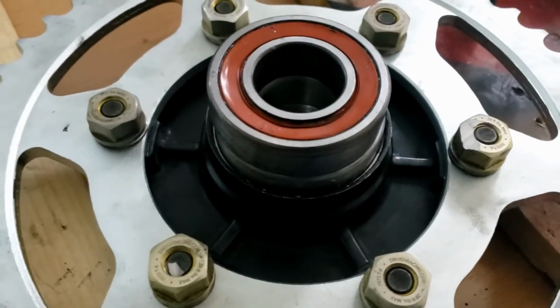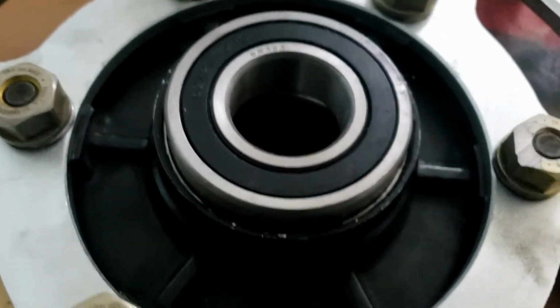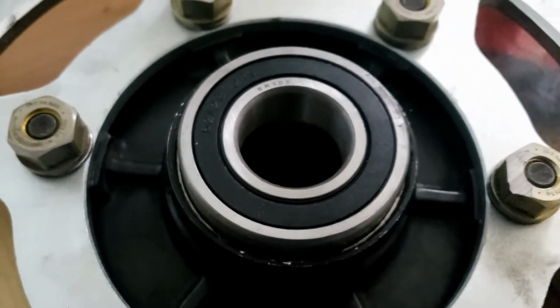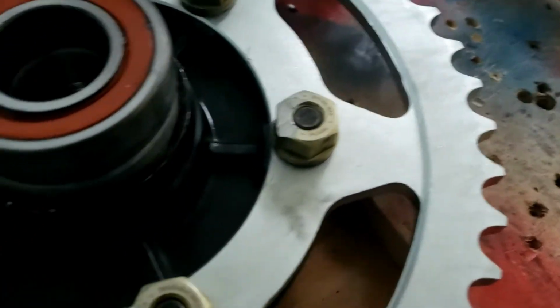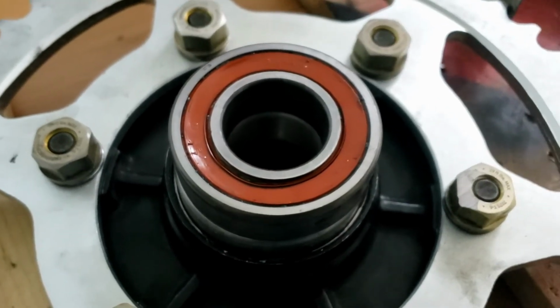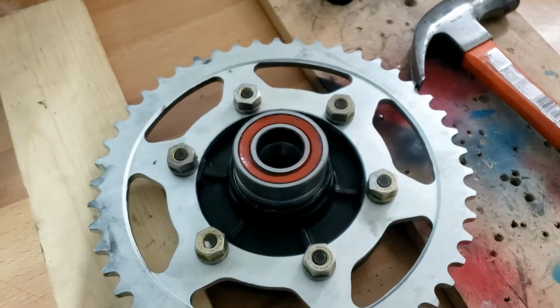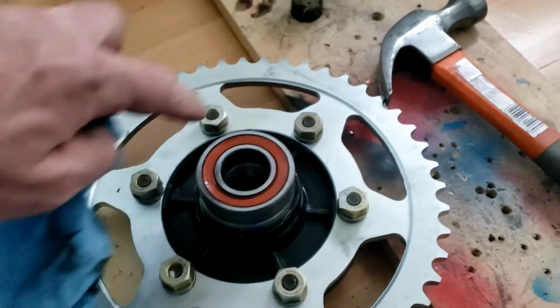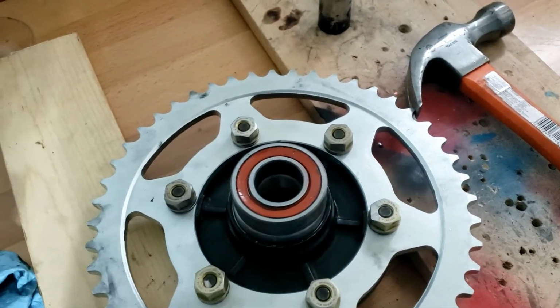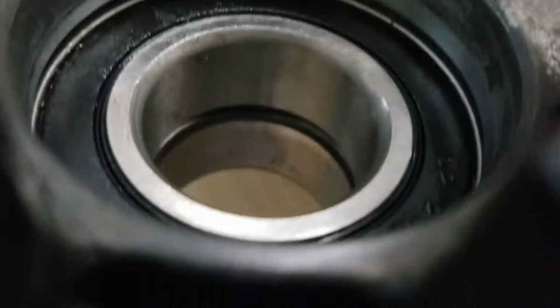And this is where the old bearing comes in. You don't want to be smacking that with something that is going to damage it. So if you use this, which is a complete match for the ring, then you're all good to go. So now, okay, I just continue tapping that in gently, little by little, around it, so it goes in evenly until it's seated nicely. Apparently you can hear the difference when it actually hits rock bottom, which it hasn't yet.